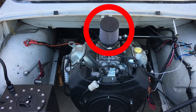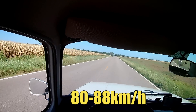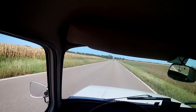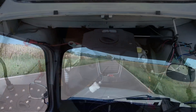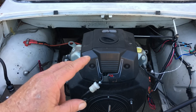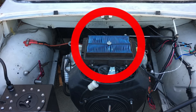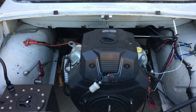Here's something to consider: the way this air filter sits on the engine, it's exposed to a limited amount of wind turbulence when the car's going down the road. This setup isn't anything near a RAM air system, but there is something I noticed. With this air filter setup, the air-fuel ratio tends to go slightly leaner when the car's going between 50 and 55 miles per hour — and that's exactly the speeds we go when we do our fuel economy tests. When we tried the original air filter that came with this engine, with all the plastic covers in place, the air-fuel ratio was actually slightly richer no matter what speed we were going. That could be due to the stock air filter being somewhat restrictive, but with all the plastic covers in place, the carburetor's not exposed to the air turbulence in the engine bay.